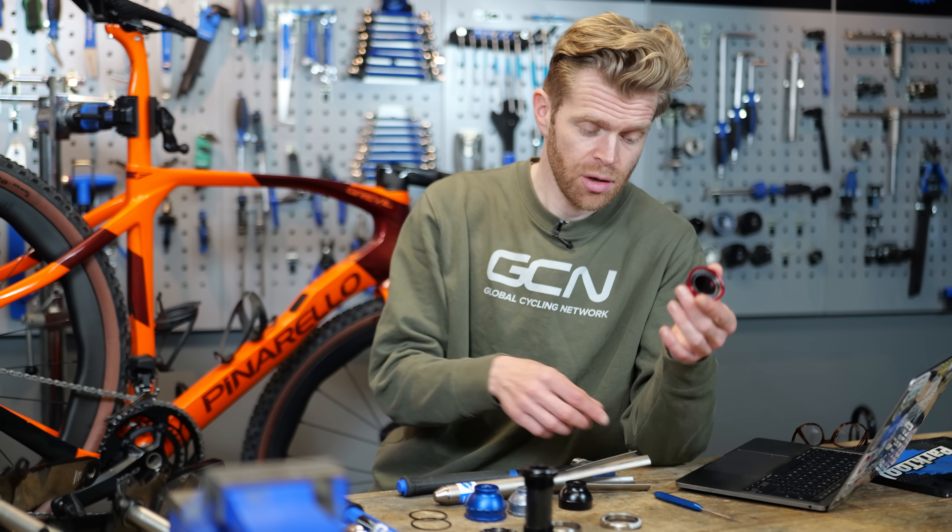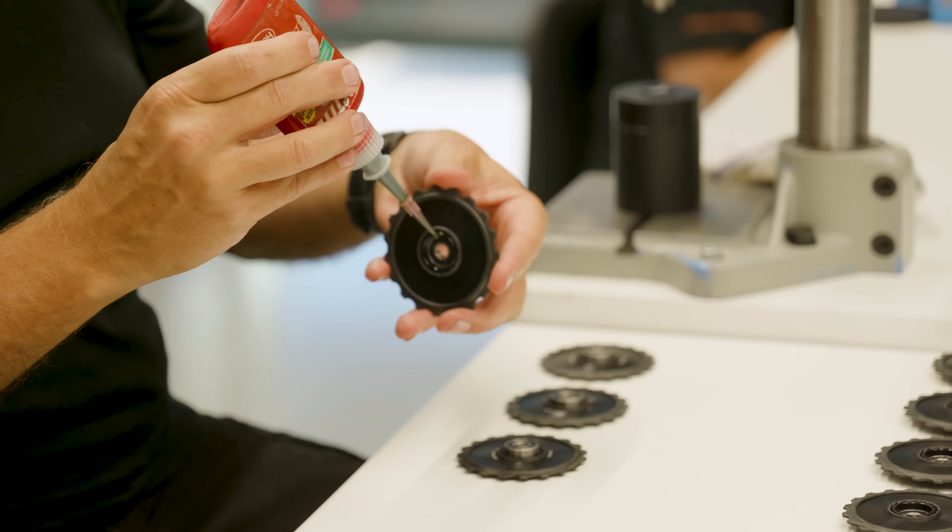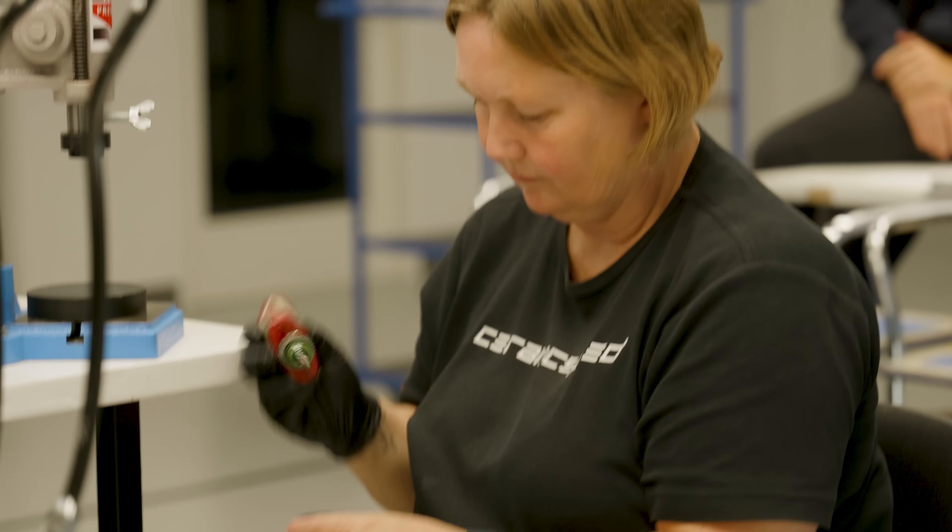Number five is a lack of lubrication and maintenance. If you're not jet washing your bike and using WD-40 with the little stick of death, your bearings will last longer. However, some servicing will also prolong their life. If you're riding especially in winter, servicing every six months — either side of winter — is a great way to do it. What you'll be looking to do is periodically remove, wash out, and then replace the grease inside your bearings, because that's absolutely crucial for bearing performance: it reduces wear and it reduces friction.